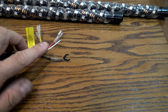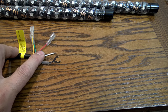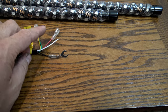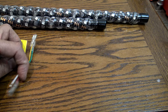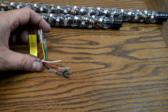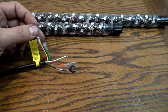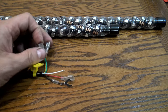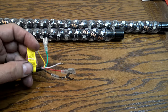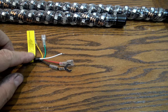For the turn signals and brake lights on this unit: black is ground, white is for the brake light — so white should be hot when you hit the brakes — red is hot all the time to power the controller. Green and yellow: yellow is for your right turn signal and green is for your left turn signal, which is a little different from standard trailer wiring.